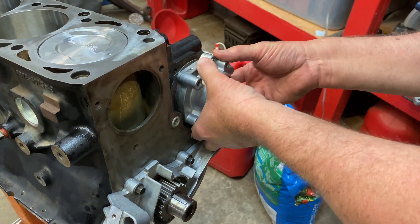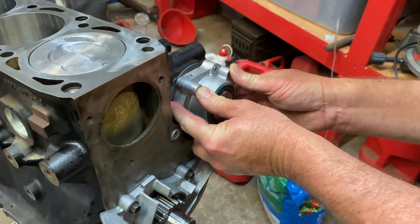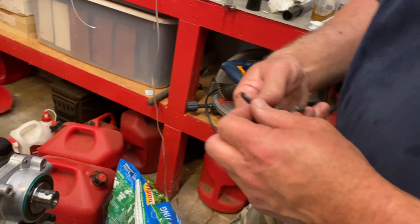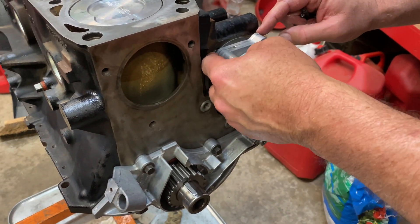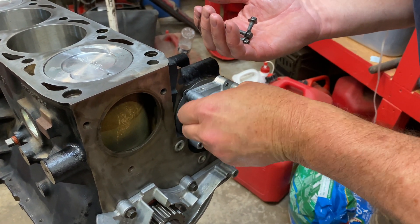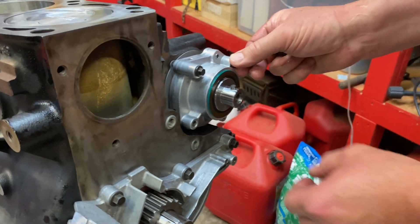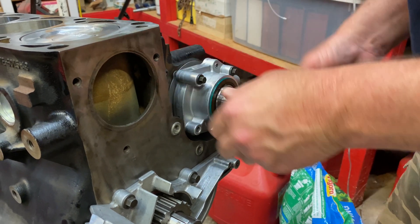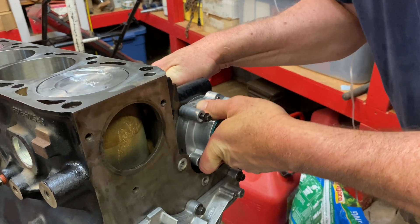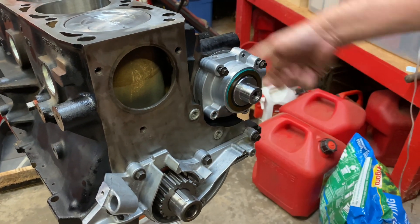Let's go ahead and slide it in. Here's where our gasket — I want to make sure our gasket gets in place without getting pinched. Also want to make sure our oil pump will go in all the way. So I'm going to go ahead and just start maybe this upper bolt here, just to keep my gasket lined up. There are four bolts that hold it on, they're all the same size — they're six millimeter bolts with eight millimeter heads on them. Now I've got the gasket held in place with just two, we just got them kind of started by hand. I want to wiggle this pump until we get it seated into the bore. Right there — it just kind of slipped right on in. The O-ring went right past where it was supposed to. So we've done that by hand, we're good to go.